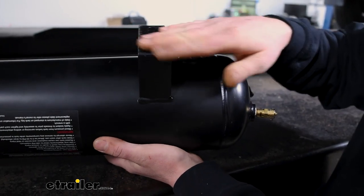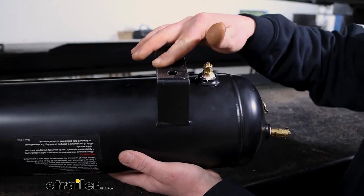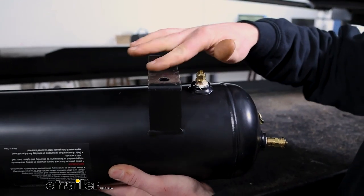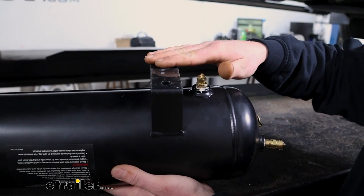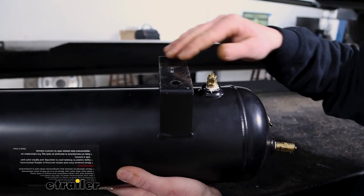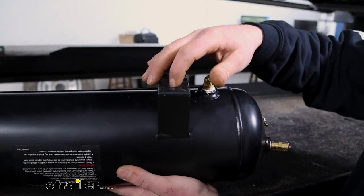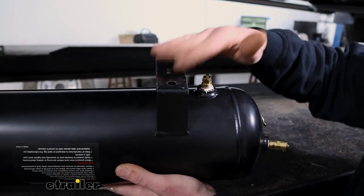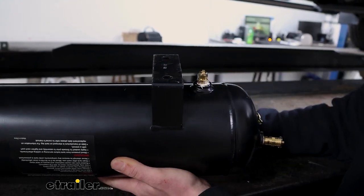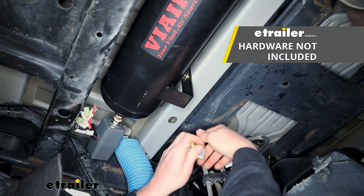Since these trucks have aluminum beds and we're going to be mounting this to a part of that aluminum, I did have some clear vinyl sticky tape — you can put a layer on that. Since this is steel and the bed is aluminum, it's not a bad idea to have a layer of protection to help prevent galvanic corrosion. Anything will work probably if you don't have this fancy stuff — packing tape, just some layer in between there. And that holds true for any metal hardware that's actually going to touch aluminum as well. So I got our tank mounted up — just slid it over our bolts and used some flange nuts to secure it real solid, it's not going anywhere. The hardware I used — you're going to have to grab this separately: two half-inch carriage bolts that are one and a quarter inch long, a spacer block, a pull wire, and a flange nut to get it secure.